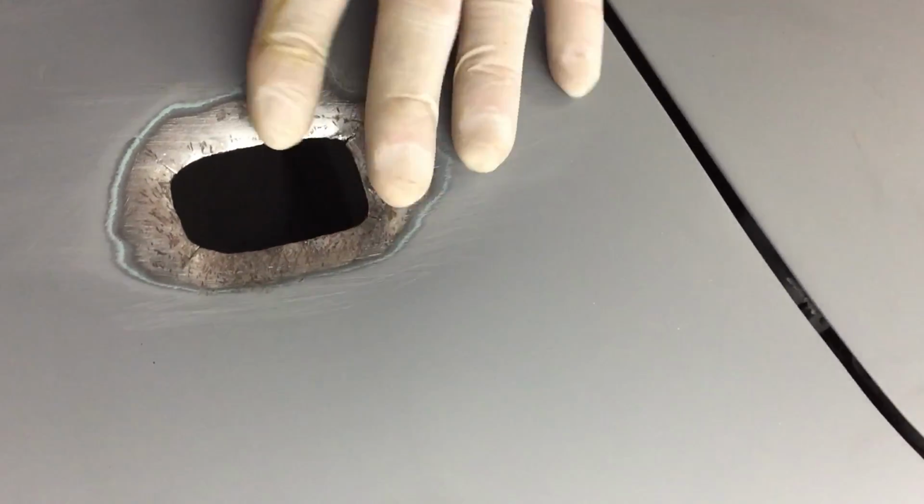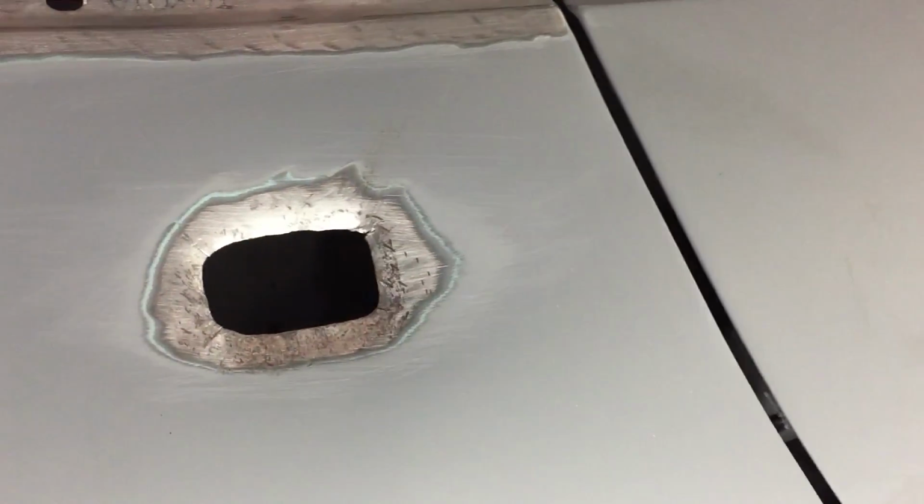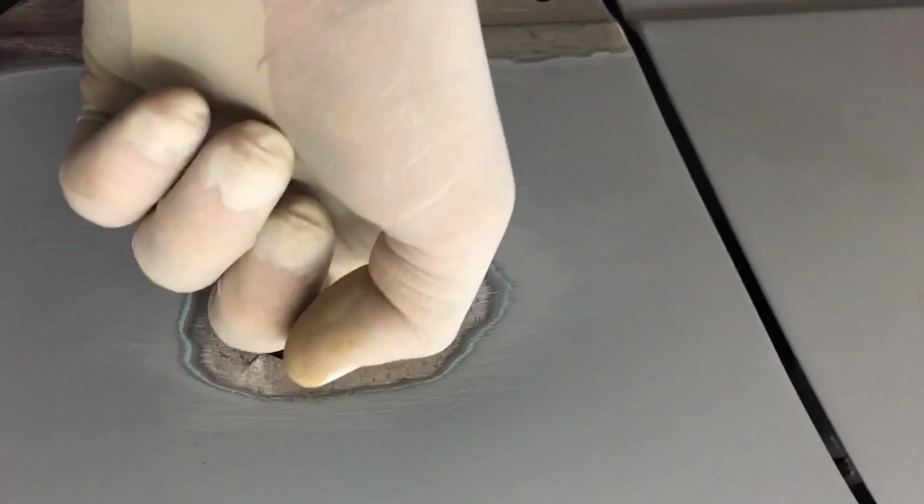Because what I was doing, I was tapping this all down. I was also caving in this guard, and when I went to pull this out a little bit to check if it was going to rest, I just popped the whole guard out and this would be flush again. So you just want to focus the force in this area. You'll have a nice concave edge. It's really hard to see on film, but it is rounded in. There we go. The rest of the guard is smooth.